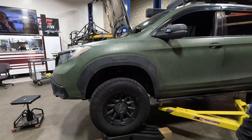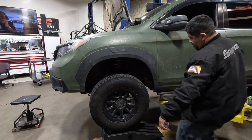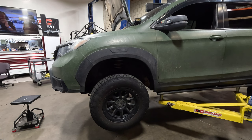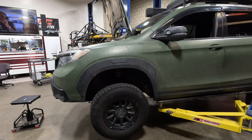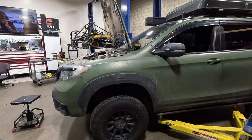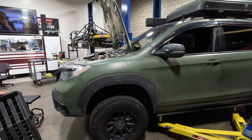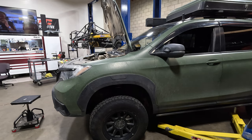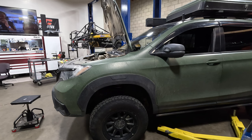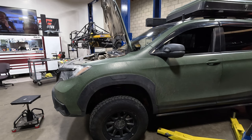In the end, we were able to install the 2023 Honda Pilot Trailsport Sway Bar, which might be the same as the upcoming 2024 Passport and Ridgeline — we'll have to see. This new sway bar ends up being a win-win: improved on-road handling, and with the perfect size sway bar end links, more off-road articulation — about an inch per side.